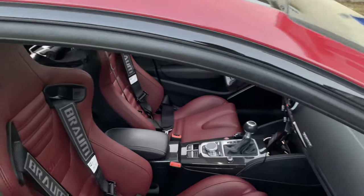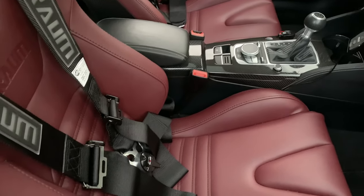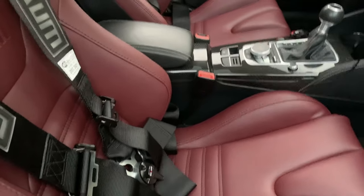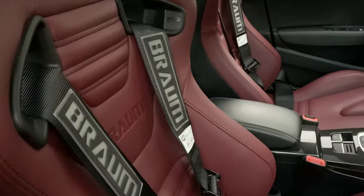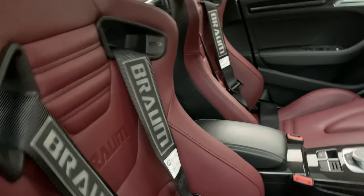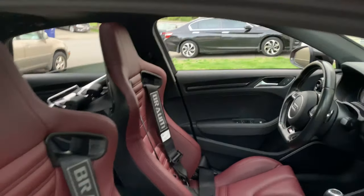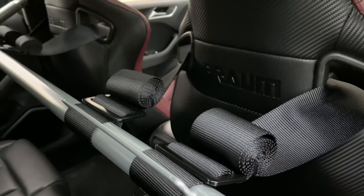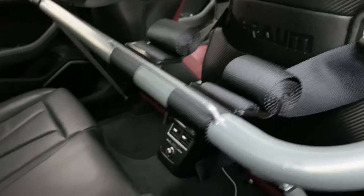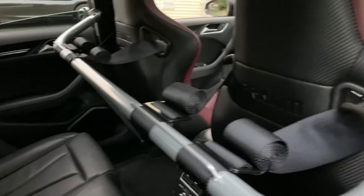This is it, everything is good to go. You want to start adjusting your harness from the lap belt first and then focus on the shoulder harnesses. My side comes down maybe half an inch longer just because I'm bigger, so I made a little compensation — if someone smaller were to sit in the car they'd need to scoot the seat forward. I tried to make it as pretty as I could and also cleaned up the car a little bit.